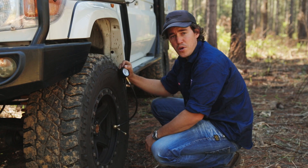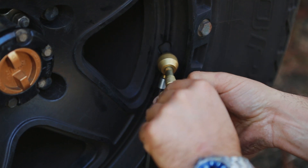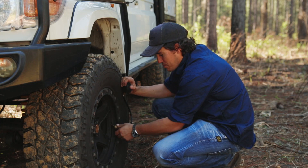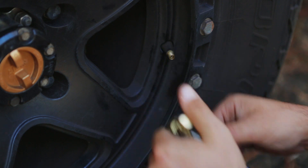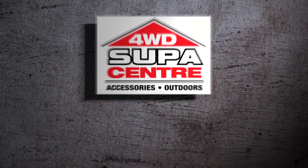Alright, that's just about perfect for off-road. Now what I want to do, I want to put that valve back in. As soon as that's screwed back in, you can hear the air stop coming out, and now unscrew it straight from the tyre valve. And that is how to quickly and easily deflate your tyres using a quickie tyre deflator.